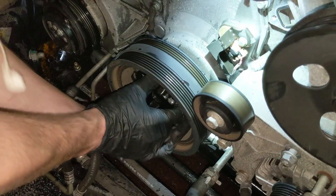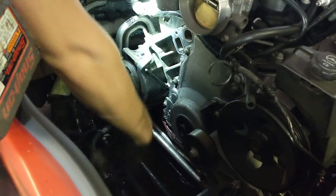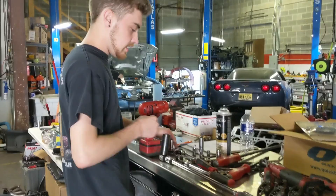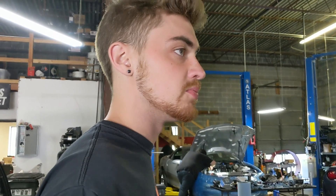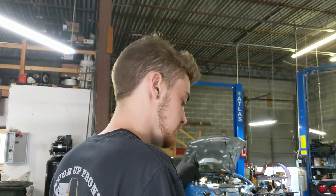The next thing we're going to feature is that burnt orange Camaro that was just on the dyno. I just loaded a tune onto it — we're gonna finish that up now. This is the whole process from start to finish: we installed the cam and cutouts. So what are you doing with this car? Cam, cutouts, water pump — all sorts of goodies. Taking that off right now. Nice new Texas Speed cam with our logo on it. Cams in, new oil pump on, put the pan back up, timing cover back on, do the springs, and then mark the cutouts for welding.